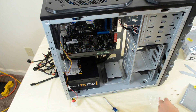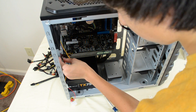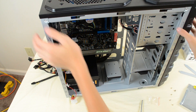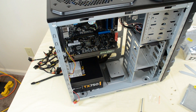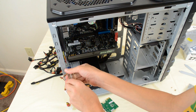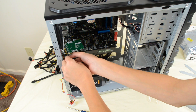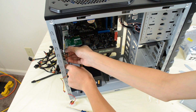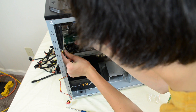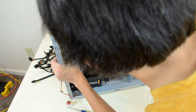I'm going to take my screw and put it in place. Our graphics card is installed. Now we're going to install our Wi-Fi card while we're at it — so if you're using a network card, make sure you have it. I'm going to unscrew that, slide the card in, just holding the edges of it to guide it — slide it in just like that.